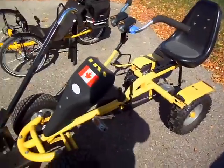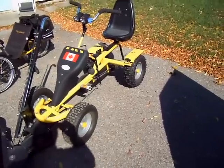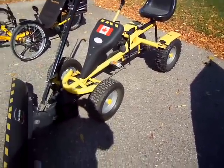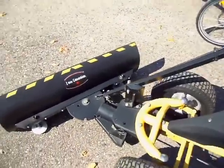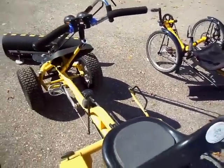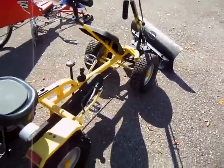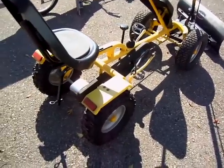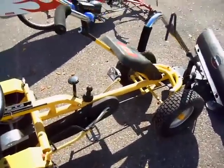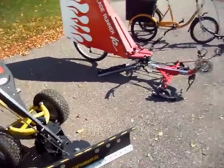And this, of course, is the pedal quad — very comfortable, much larger and heavier. I acquired it used and modified the seating to accommodate a full-size adult. I then changed the gearing, lowered it down, and spent the rest of the time developing this fully articulating plow. It turns left and right, lifts up, and all the controls are accessible from the seat. It's a little heavier, but it does move more snow — you can use that speed and inertia to push a lot. In the future I plan on changing the rear end and the gearing to make that more universal, but for the meantime this is quite a nice machine. I do like the quad design for its stability — much more stable than the tricycle over there, which sits high up. So it's like a semi-recumbent design.